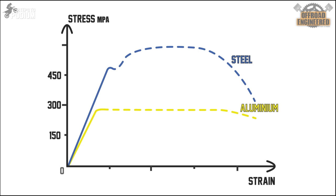This is the tensile strength curve of steel and aluminium, which tells us how much load a material can withstand according to its deformation. We only care about the maximum load each material can withstand without becoming permanently deformed. We can clearly see that steel can withstand a load over 1.5 times greater than aluminium. No wonder aluminium frames feel so much stiffer than steel ones — aluminium simply can't flex as much as steel. Considering the mechanical properties alone, it's no surprise that all dirt bike frames were made of steel until 1997.